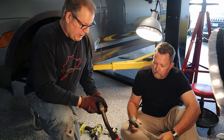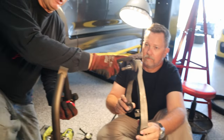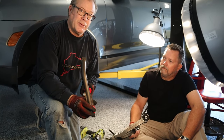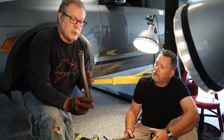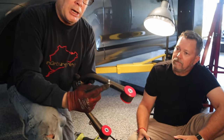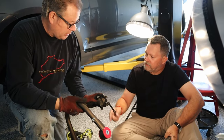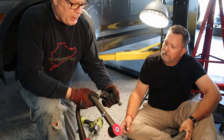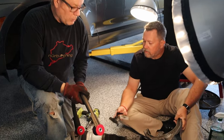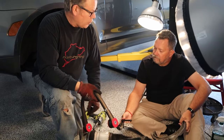You'll notice these are pretty different. This one has a bit of an angle — this is more angled than the old one, and there's a reason for that. The three-inch lift really creates some problems if you put the stock arm back in, so this has been optimized specifically to account for that three-inch lift. They also give us this fitting here that actually helps to reposition the ride height sensors. We'll take the old bracket off and replace it with adjustable parts from Eurowise — but we reuse the sensor itself, just replacing the arm.